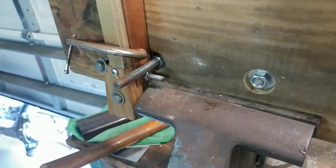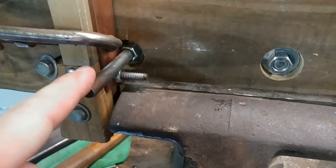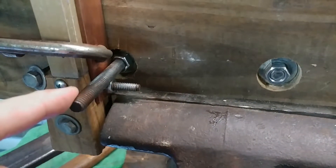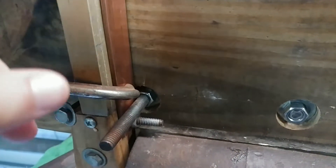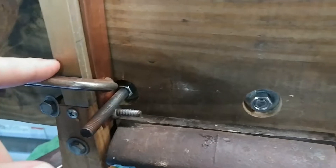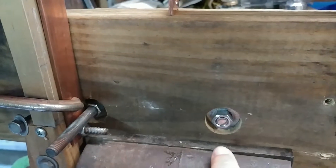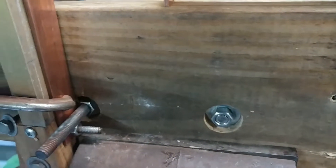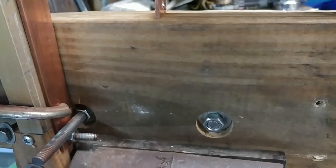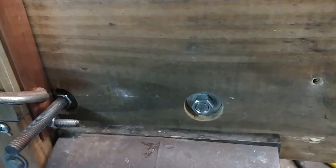To do that, Dad and I have made this bending jig where first it's bent around basically just this bolt. Dad figured out how to add this die thing here to keep that bend tight, and then we screw on a block that sits above here so that it can then be bent around this bolt that we extend. That way we can bend it past 90 degrees a little bit, let it back, and then put it on that one and bend the other end.